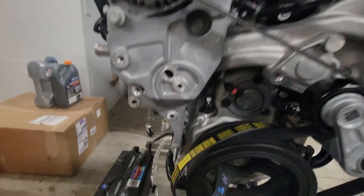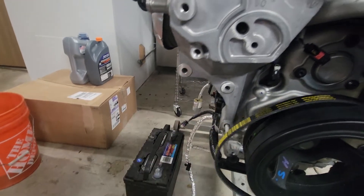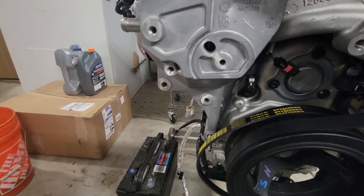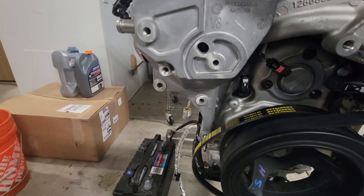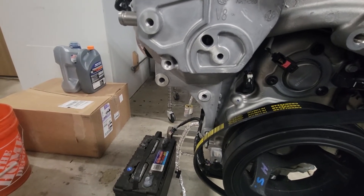All the bolts over here are the same. Even the alternator bracket bolted up fine. I don't have the A/C compressor on yet — this is the stretch belt for it, and I'm probably just going to leave that hanging in the truck. The refrigerant is R-1234yf and I don't want to mess with pulling the charge out since it's expensive.